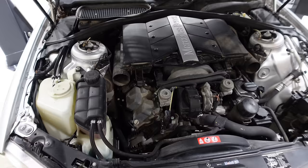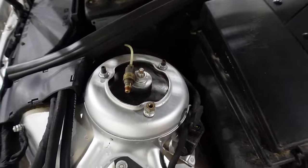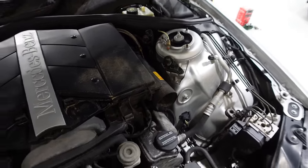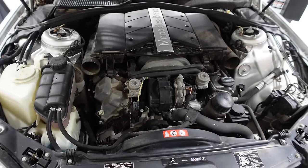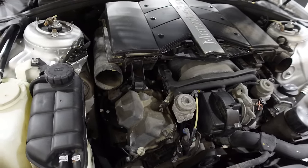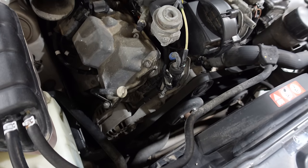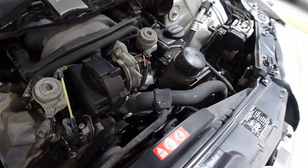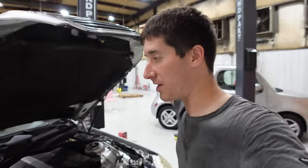Under this big beautiful W220 hood we've got nothing but problems. The air struts don't exist at all - just the lines and check valves remain. A used set of air struts will cost about $1,000 - and they might not even work. There's also an idler or tensioner bearing failing in the accessory belt system - could be the alternator, but I think it's just the idler. The valve cover gaskets are shot, and there are probably more gaskets shot in this engine.